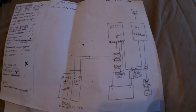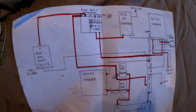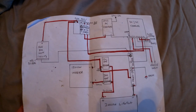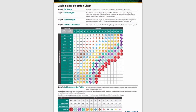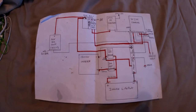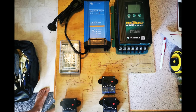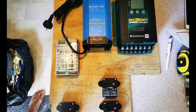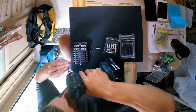I had to do a wiring diagram — a very simple one at the start with a list of components, then finalized into a proper wiring diagram. I got help online to work out what gauge wiring I needed and what sort of circuit breakers. Then it was a matter of turning that piece of paper into reality. Quite a bit of time was spent configuring the board and finding the most efficient position for each component to reduce wiring lengths. I gave it a quick coat of paint and screwed all the main components to the board.